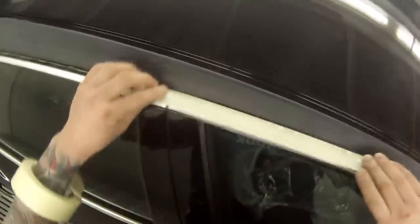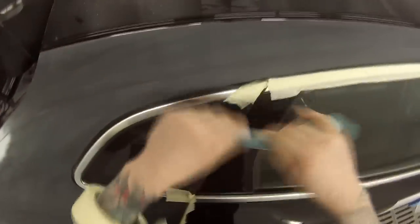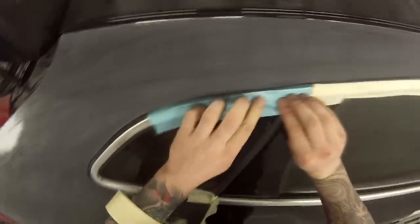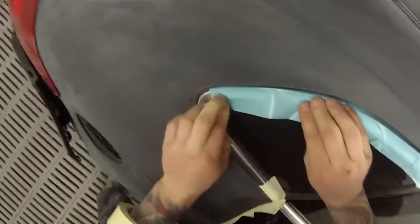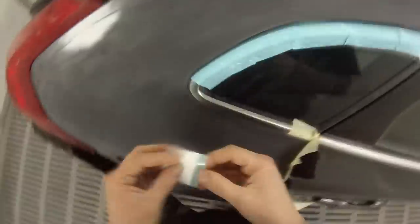Just going around the entire job back masking and peeling it back just a touch, because those rubbers actually touch the painted panel. So you've got to pull that rubber back down a bit, and just using that trim masking tape around the rest of that quarter glass — slide it in, pull it back, and tape it down. It's good stuff this. There's loads of different brands — Jay Tape has a good one with perforated edges so you don't have to razor blade it, but it's whatever works for you.